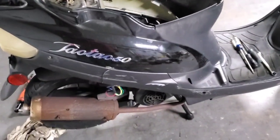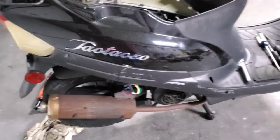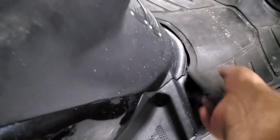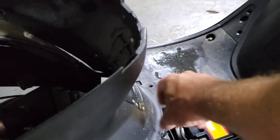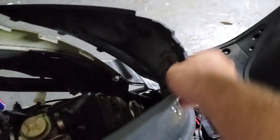It was also very low on oil, so the assumption was that it was leaking oil out of the gear case. The gear case is completely full of oil, so it had an oil leak and it was actually coming out the bottom of the valve cover. Now I've taken it off and I should have just done the valves the first time when I was in there, but I didn't, so we're going to have to do it again. Dan's not happy because I just had all this off and now I have to take it all off again to do the valve adjustment. Very chattery, so we're going to solve that.